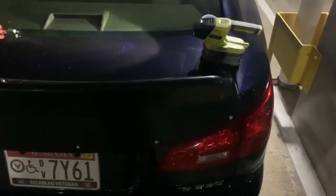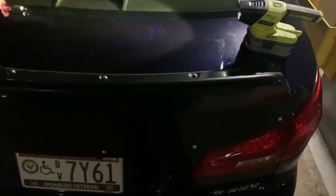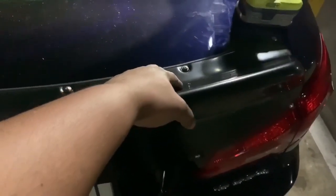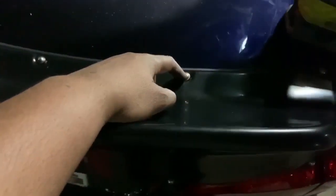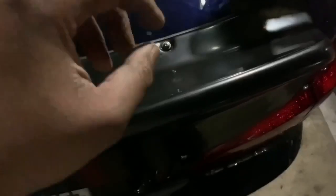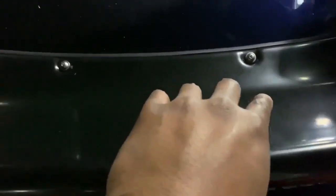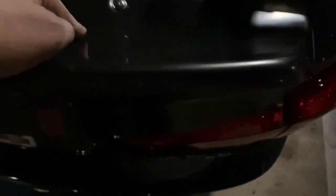Here's the finished product. It would have only taken a couple hours — hour and a half — it's really not a hard job. But I ran into some trouble with the duckbill, so it is longer than a two-hour job depending on who you ask. I ended up going to a quarter-inch hole for the spoiler, just so that the bolts had room to move around and find the rivnut on the trunk — find the threads. When you thread something in plastic, the plastic catches on the threads. So I went up to a quarter-inch hole on the spoiler to give some room when trying to locate the hole, because it's not a perfect fit. You have to push on the spoiler, push down on it, push sideways to try to get the bolt in.